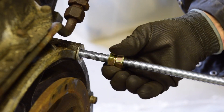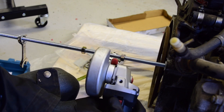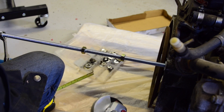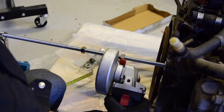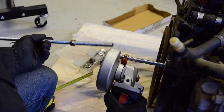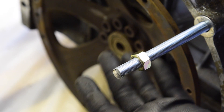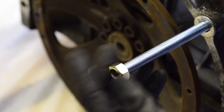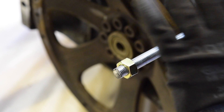That's fully wound in. The Dremel won't work because the blade's too small and I can't get it straight, so I think we need to go big or go home with the angle grinder. It's quite secure. Interestingly, I thought the angle grinder would ruin the thread at the end, but I've literally just not tidied up at all and that will go straight in, no problem at all. I'll do the other four — I won't bother videoing it, save you the boredom. Then we've got the studs and we can start putting on the engine stand.